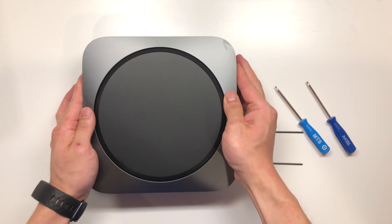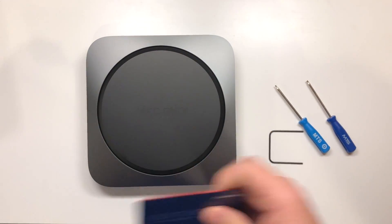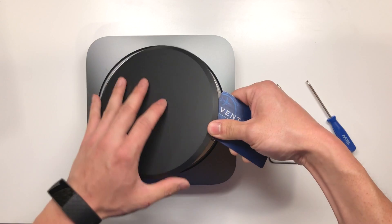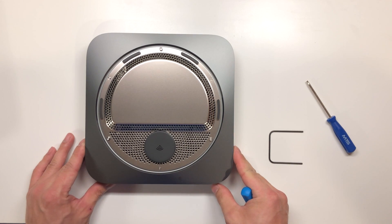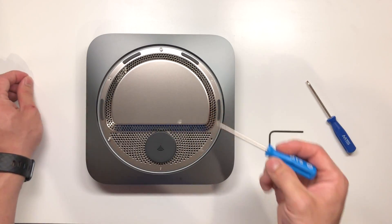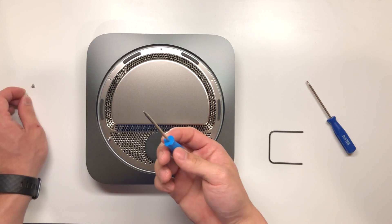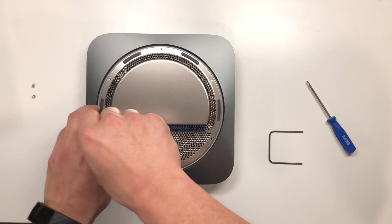Let's go ahead and get started — let's pop off the back panel. This year's model looks great with the space gray. To take off the back, I'm just going to grab a credit card and pry it gently up. The bottom is popped off. I believe this is still the same type of screws as the previous year's model, so I'm going to use this screwdriver — this is a T6 Torx security screw. It has a hole in the center, so be careful when you purchase these, as these aren't standard Torx screwdrivers.